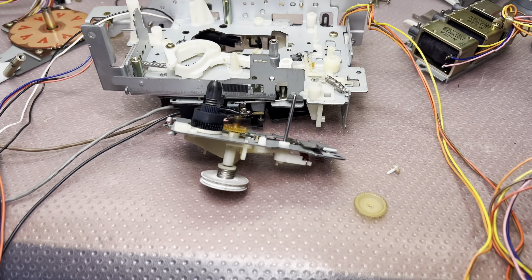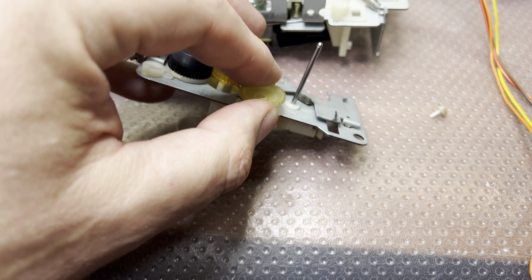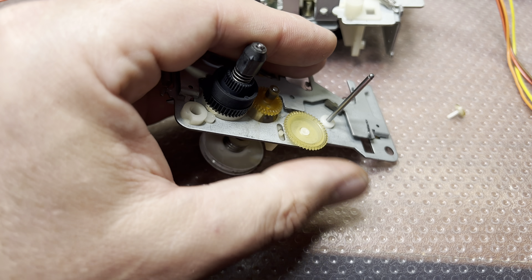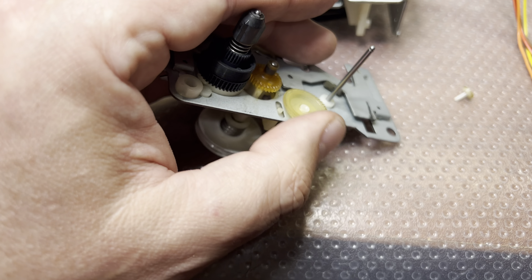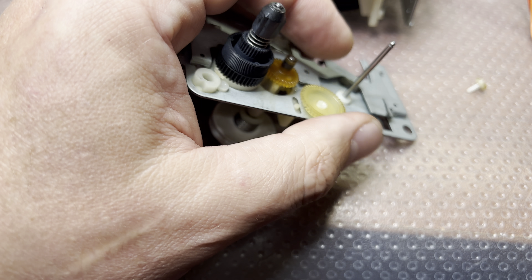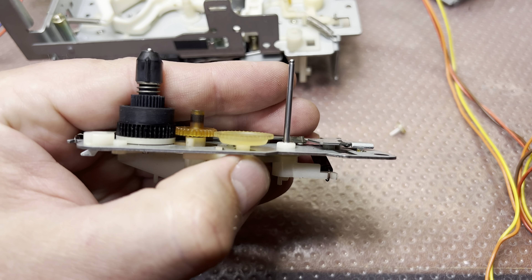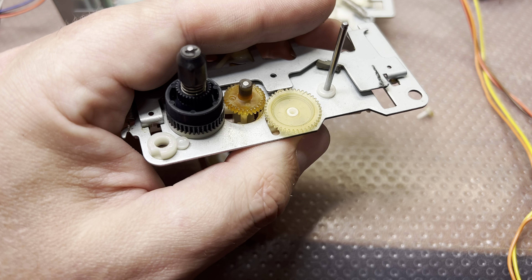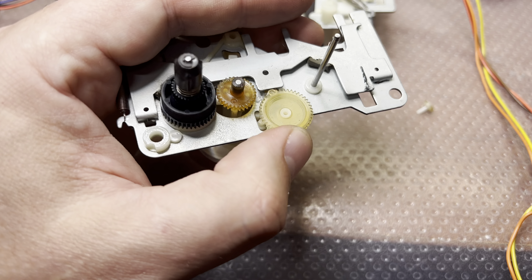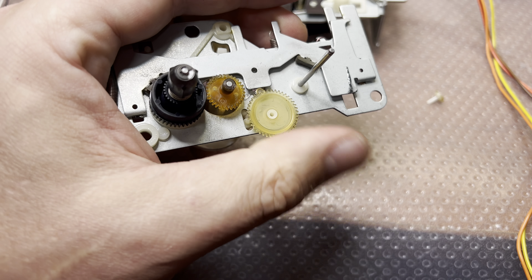Welcome to the third full disassembly of the Hitachi tape transport. This gear, which sits here, was not rotating — I still didn't clean it and it still rotates pretty tough even after I remove it. It has lots of friction, and that's what I have to fix. This gear mechanically connects to a second gear to transfer energy from the motor gear to the reel, so if it doesn't rotate freely it will slow down fast forward and rewind in both directions. It's quite significant friction — you can see it's not rolling free.